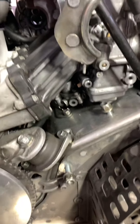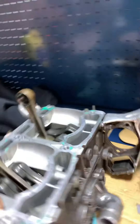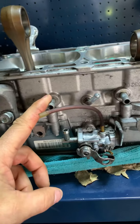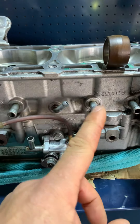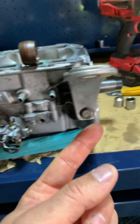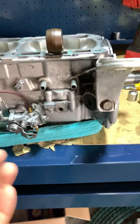The only thing I ran into was the fuel pump. On the P-Tech engine, you have these lines — one runs to the RAV valves, and one is for your fuel pump, and one's for the oil. That fuel pump nipple is not on the E-Tech engine, so it's just blank. What I did is I teed into the RAV valve lines because those ones tee off and go to the RAV valve. I teed into that, and now my fuel pump works.